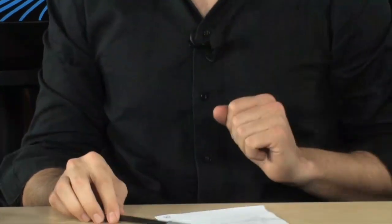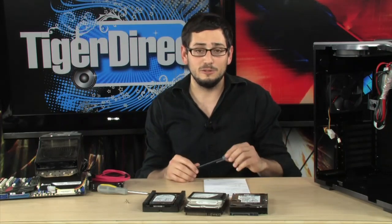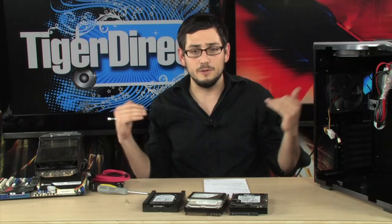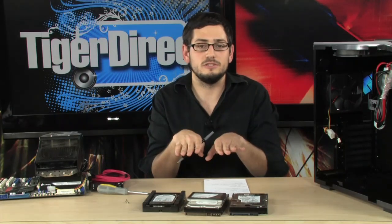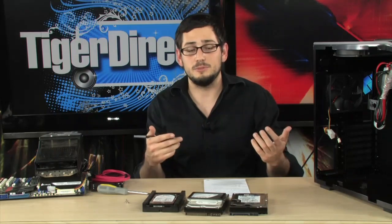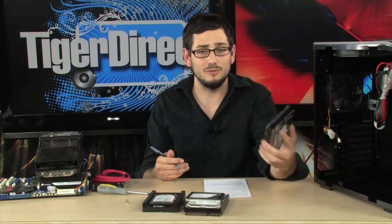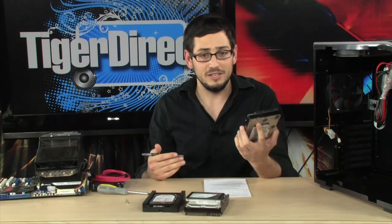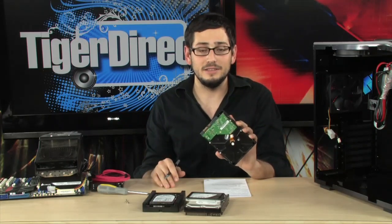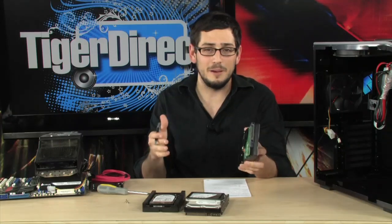Let's talk a little bit about RAID. If you're all about performance and want blistering fast speed, RAID 0 is what you want. It basically splits the output from the motherboard across two hard drives so they can both write as fast as possible. The problem is if one drive fails, all the information is lost — so it's not as reliable, but you do get increased performance. RAID 1, on the opposite end, is basically a redundant backup — it writes the same thing to two different drives, so if one fails you always have a backup. To keep it simple: RAID 0 gives added performance but decreased reliability, while RAID 1 increases reliability but keeps performance about the same.